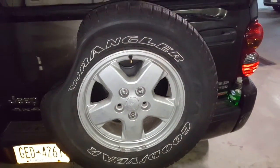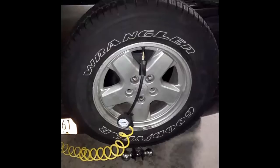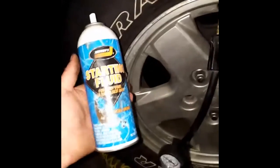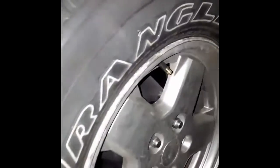That's one messed up looking tire. I have my compressor hooked up and ready to go — I'm going to turn it on. Right away you can see as soon as I turn the compressor on, this tire was taking air right away. I'm just going to inflate this to 36 PSI, and that is how you seat the bead of a tire with just some starting fluid and a lighter. The bead is set.